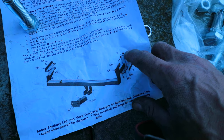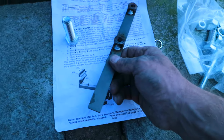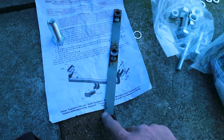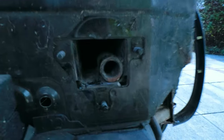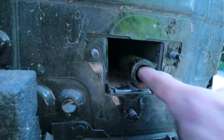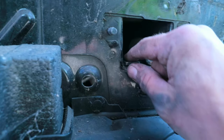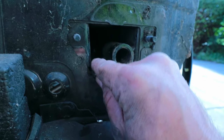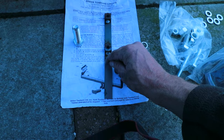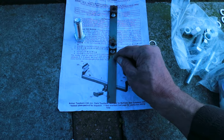I've run into a slight problem here. As you can see on the diagram, bracket D is a certain width and then it gets thinner with a little sticky thing sticking out of this end. But the D that I've got is not like that — it is the same width all the way back. Which is a problem because on this car we have a screw section for a towing eye welded into this box section, and that's not going to come out. If I put this in where it's supposed to go, it gets in the way and stops me from lining the holes up correctly. So I'm going to have to modify this with an angle grinder, cut it down so it's nice and thin, make it the right shape, and then that will allow me to get it in properly.